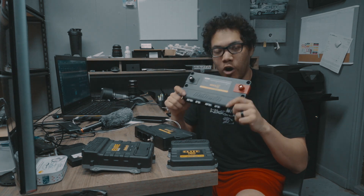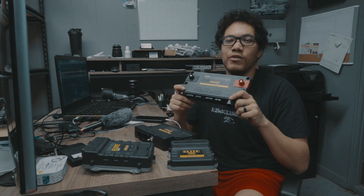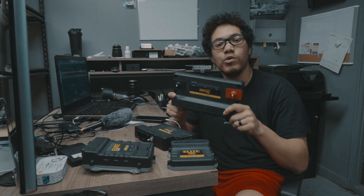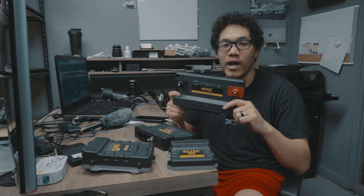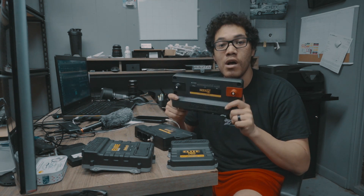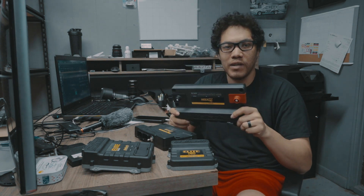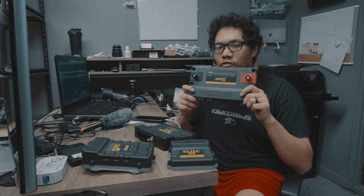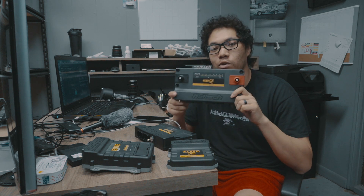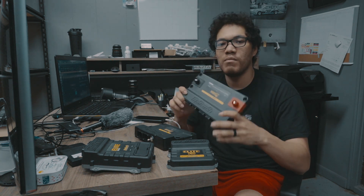A good example: say I took a car down the drag strip and a fuel pump on the edge blew its fuse at the end of the track. Normally I'd need a replacement fuse or a tow back to the pits to figure it out. On the Nexus R5, I can set it up so the fuse automatically resets after say 30 seconds, allowing me to start the car and drive back to the pits to diagnose why the amperage is spiking. For guys who are afraid of wiring, this simplifies everything — the computer tells you exactly where the wiring issue is because the PDM is built in.